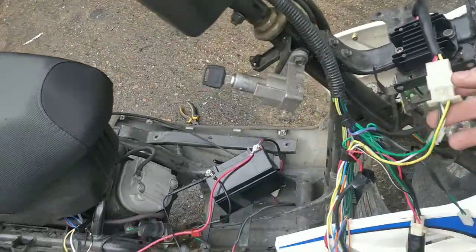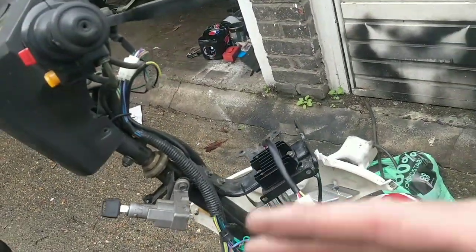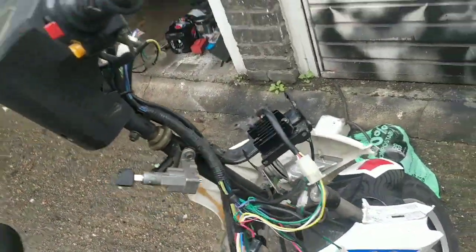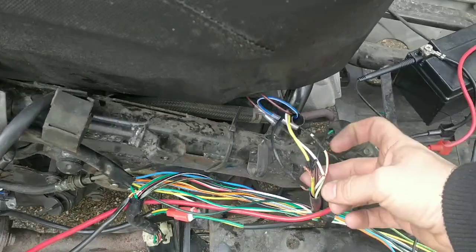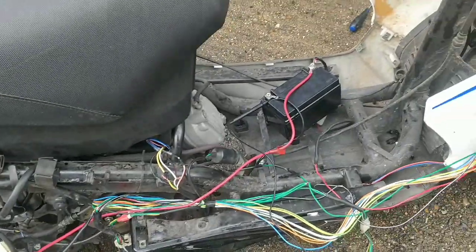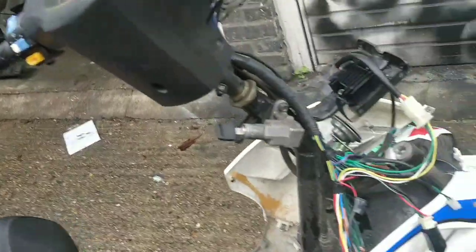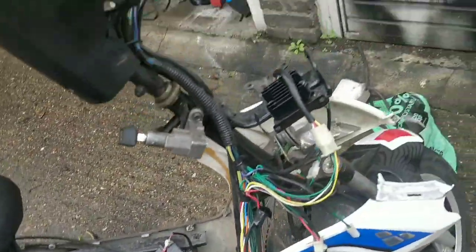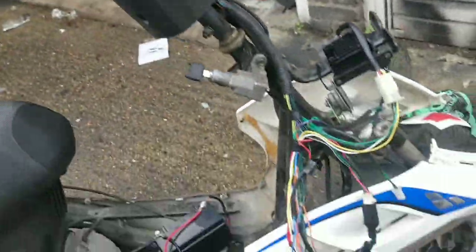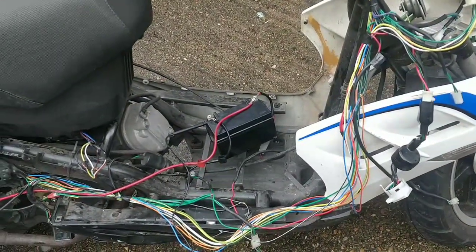Now the output of this one is all above 12 volts from here, but obviously it's not on load. I mean, the battery's there, but it's not getting down to there, so it's not on load. I checked the wires again here, DC voltage, and they definitely are putting out enough voltage, and the voltage is rising with revs. So I don't know the next step. The next step for me is a brand new £55 wiring loom first, and then if that doesn't work, another regulator just to check, 12 quid or something. So I think there's just no other option.